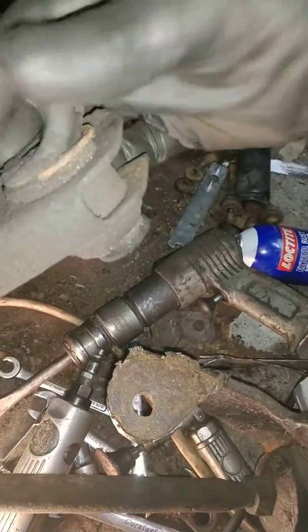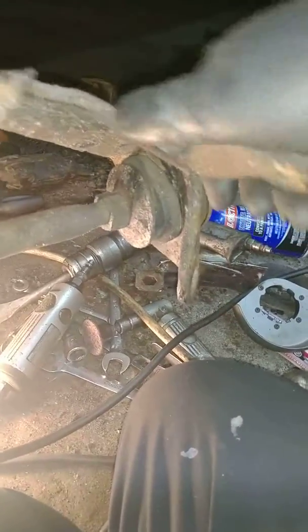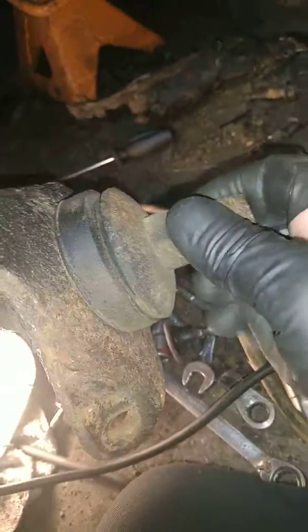Hey Samantha, this is your lower bushing — it's gone. The rear lower ball joint doesn't look bad and doesn't feel bad, but it's original. That weird looking bell shape on top is old school. Your strut rod bushing is here — I gotta take this off to make sure it lines up. There's a little bit of play in this, even when you hit the brake you'd feel a little clunk. It's right at the borderline, but it also looks pretty old — it still has the original stop nut here.